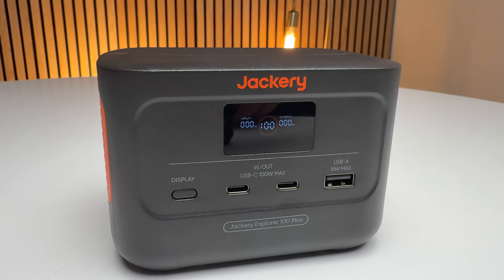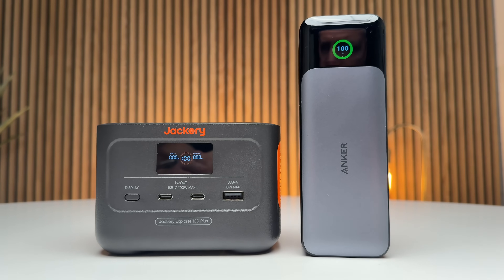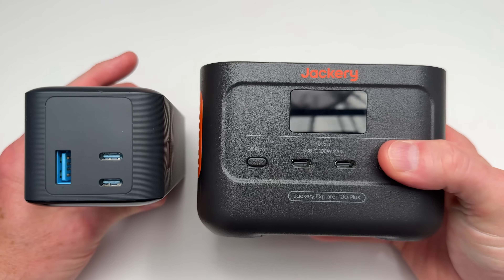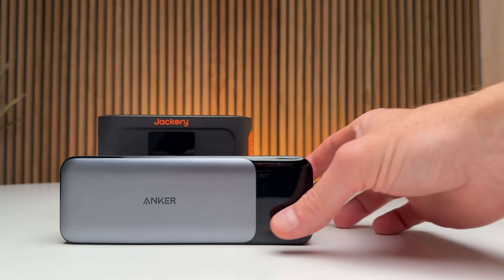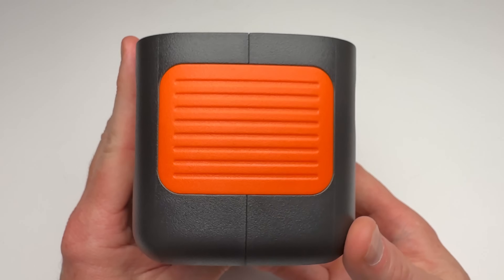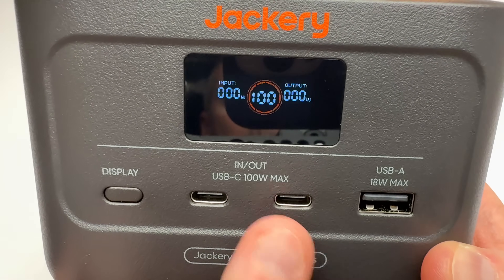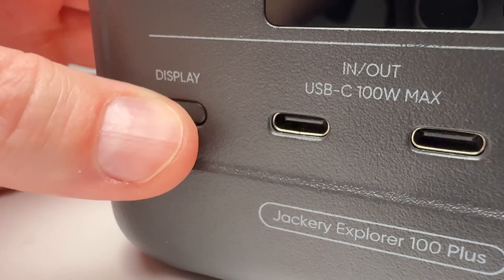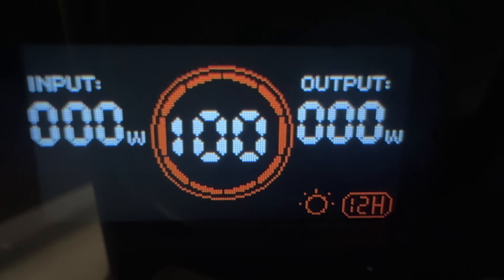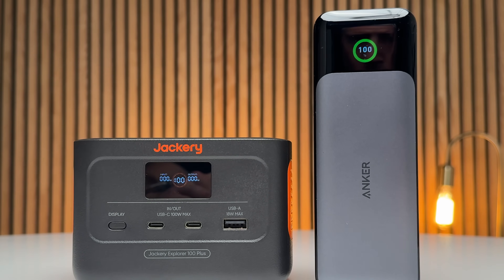Spec-wise, this is similar to my original micro power station, but it upgrades the battery to LFP chemistry rated at 2,000 cycles, so it has at least 4 times the lifespan of the Anker 737, and is much safer too. It's more of a cube shape compared to the long square shape of the 737 and weighs around 50% more at 34 ounces or just under 1 kilogram, because LFP batteries are less energy-dense than typical lithium-ion batteries. The Explorer 100 looks like a tiny version of their larger power stations. There's a pair of 100-watt USB-C PD 3.0 ports and an 18-watt USB-A port. On the left is a button to turn the display on and off. There's a color display that shows the state of charge, input and output power, and time to empty or full, just like their larger power stations.